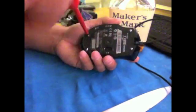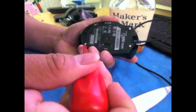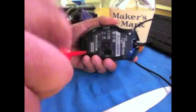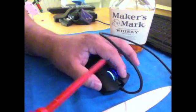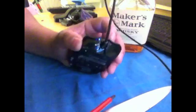Now this is the tricky part at the end. Remember that last screw I was talking about — the one where your left button is — don't tighten it too much. The back ones are okay, just tighten them regular. The one near the left button is sensitive. Give it a tight all the way and if you notice it will start to click perfectly. If you over-tighten it, what will happen is it won't let it click down. But when it's right you'll hear it — it's like brand new.